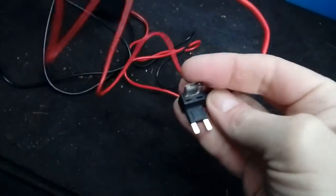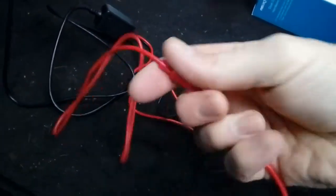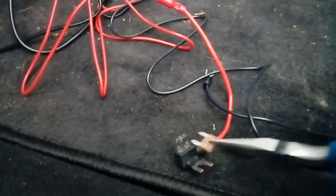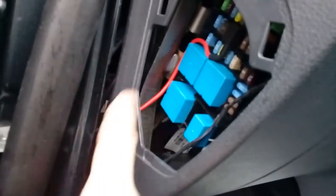The mini blade fuse spur — the fuse in the inline holder runs your camera, and the socket at the side is where you put the fuse that you pull out of your fuse box, so it effectively doubles up the socket in the fuse box. Bullet connectors are already on them; you just push them together. Then get yourself either the tool that comes with the car or long nose pliers, take the fuse out, pop it into the side socket of the spur, and then the spur goes back into the empty slot. When putting your fuse spur in, make sure you tuck it behind the dashboard — you don't want it to overlap through the hole.